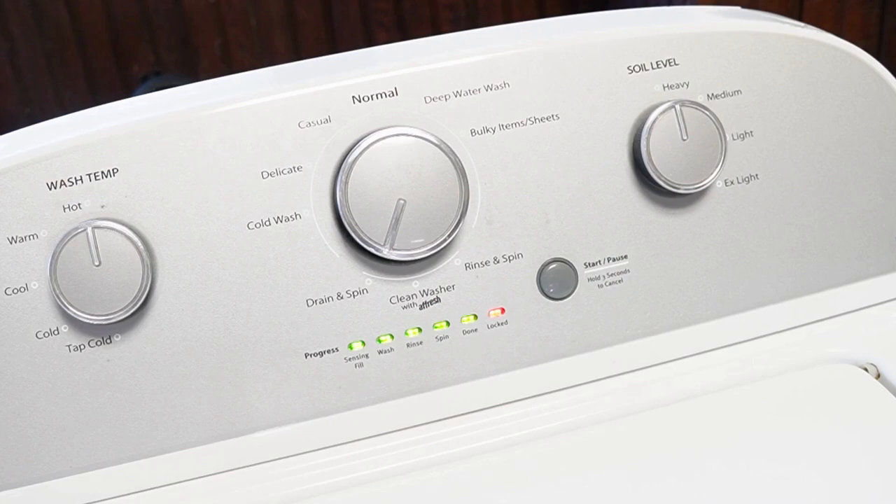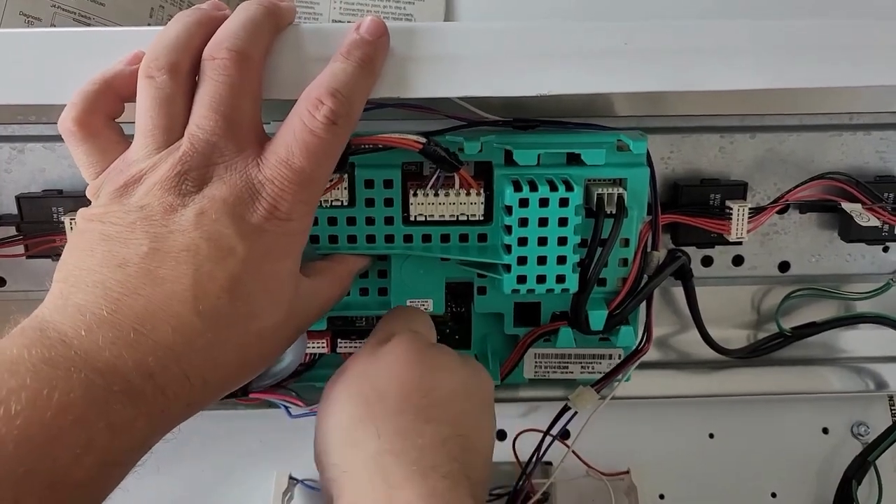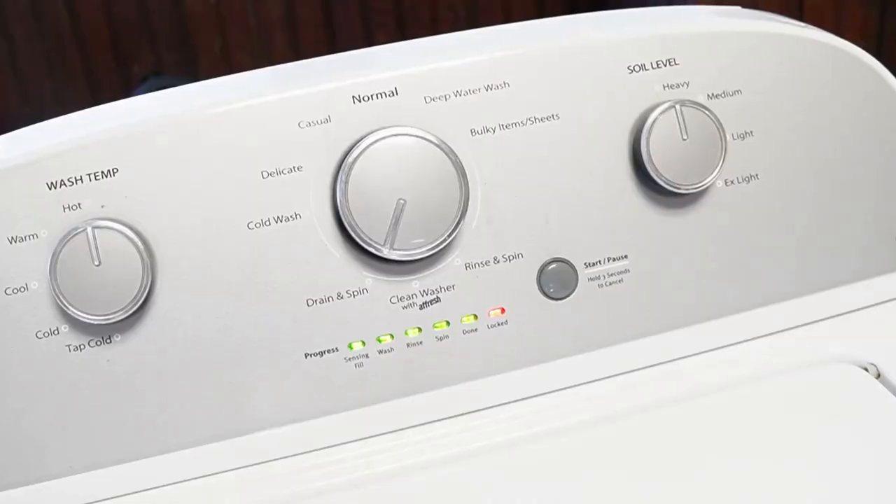This is a must when parts aren't working right, or the machine just doesn't know what state it's in — like if you've replaced the shift actuator or even a control board. During this time you're going to hear all kinds of noises from the machine, and that's totally normal during the approximate three minutes. When the calibration mode ends, every single light will turn off, including the lid lock light, and the machine is now ready and recalibrated for use at an optimal level.